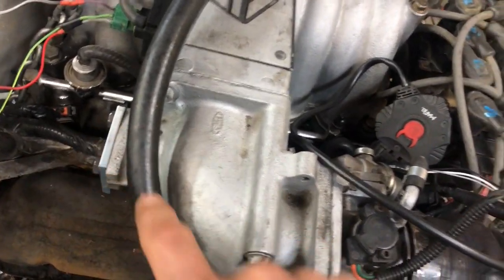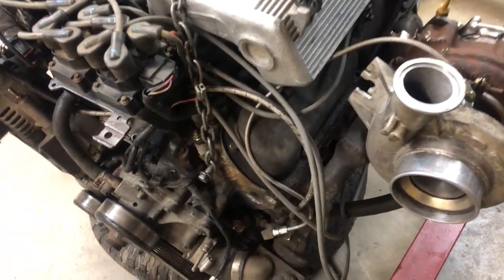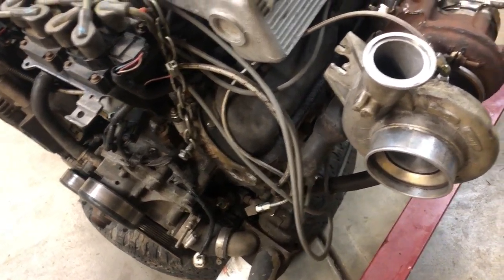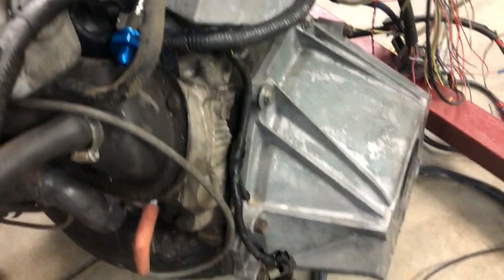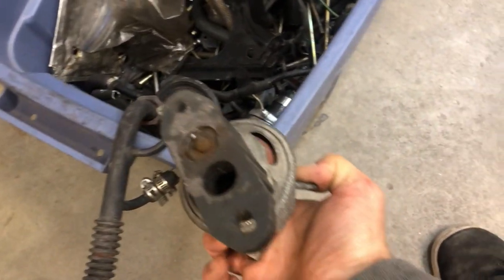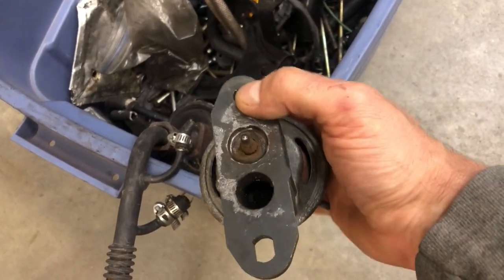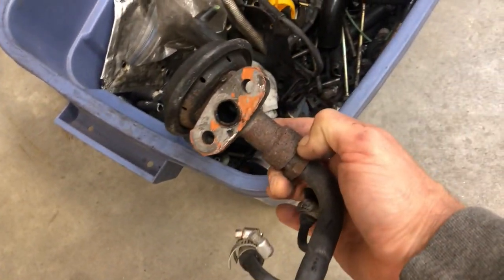There is also an EGR valve difference on the earlier ones — they didn't have the DPFE system; the later ones did. If you're looking to run EGR, you'll want to make sure you get the right harness and ECU to match the system you want to run. I'd recommend the DPFE because it was used on most of these 302s. I have one of each here to show you: this is the DPFE style, which uses a separate pressure sensor, and this is the sonic style. They have a different flange — this one is significantly larger. The sonic style is an internal EGR and can only be used if your heads have the internal flow passages; otherwise you'll need the DPFE.